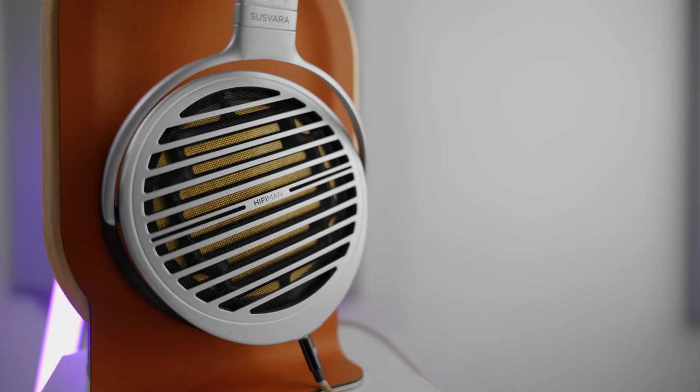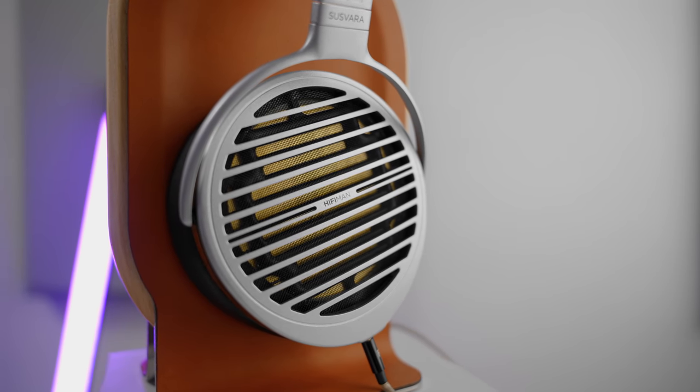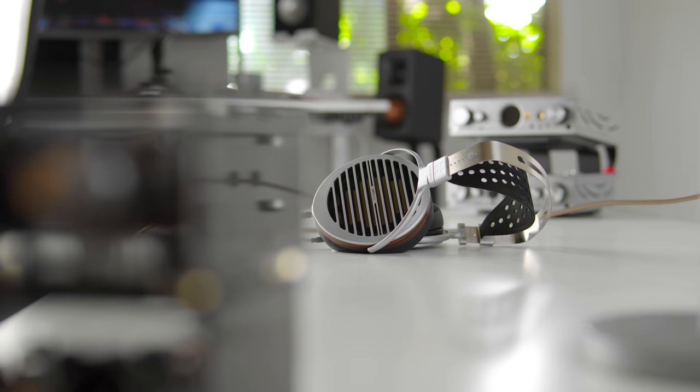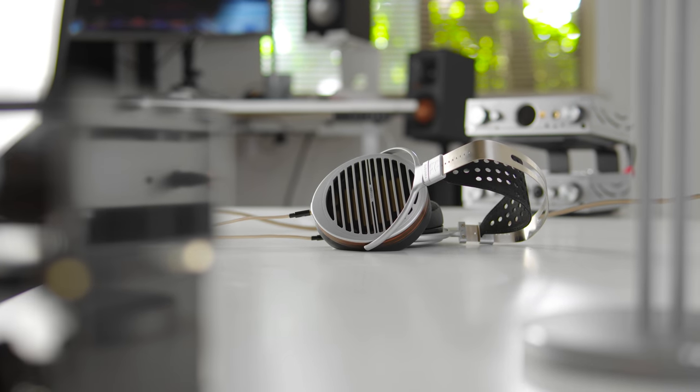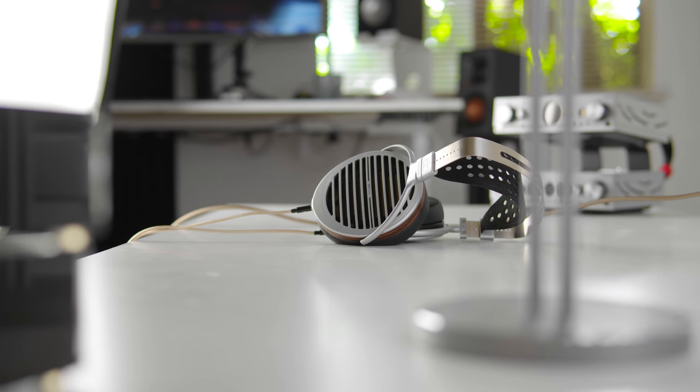Initially when I heard this I was pretty unimpressed and it sounded off, but I couldn't verify why until recently. I reached out to try to get a second unit for review, but with a six-thousand-dollar headphone that wasn't easy. I was able to get a small measurement rig and verify what I'd suspected from the beginning: a channel imbalance — actually the most consistent channel imbalance I've ever seen, basically 1 dB all across the board, with the left ear louder than the right. When you reduce the left channel volume to match, you get some very impressive measurements.